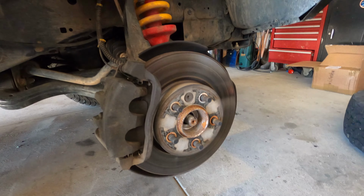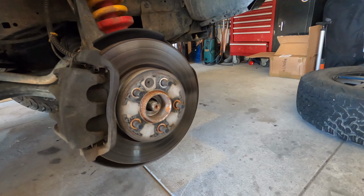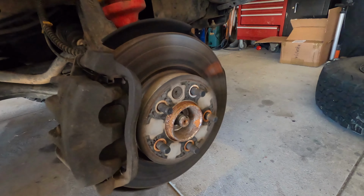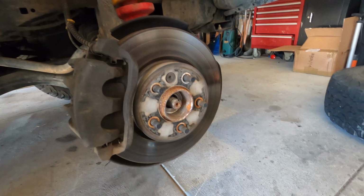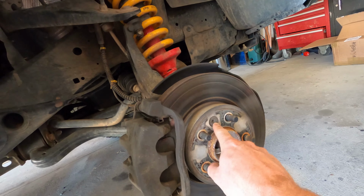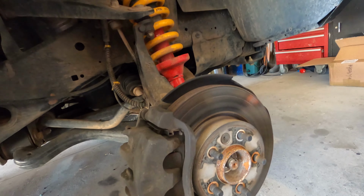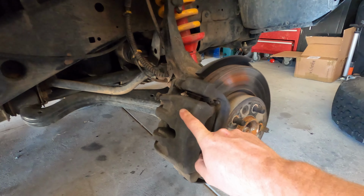Alright, so first things first, you got to pull your CV nut off, which is 1.25 inches. It is good practice to just pop your cap out of your rim and just leave the car on the floor to crack that nut off, but I forgot, so all I'm going to do now is you got your, I forgot what they call it, the star hex Allen key to pull the rotor locking plate off, or locking nut, and you've just got to pull your caliper off.